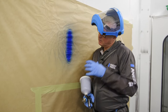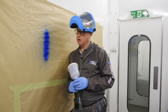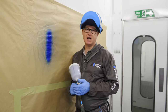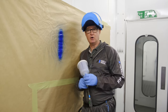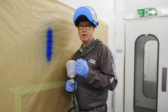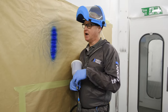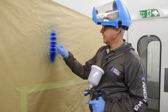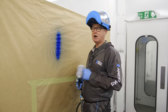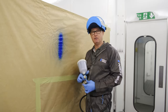The atomization is really consistent top to bottom. What we've done is concentrated predominantly on the front end performance. In the past with the old series we had one cap that did both base coat and clear coat — there was always a bit of a trade-off. You'd work hard to get clear coat right but there'd be a slight trade-off with base coat, and vice versa. So now what we've done is designed a designated air cap for base coat and a designated air cap for clear coat. With the new base coat compliant air cap we've been able to fine-tune the pattern — get the shape, width, and softness we want. Straight out of the box application. We'll now spray out a Series 1 against the Series 2 and show you the differences.